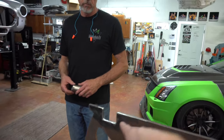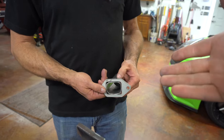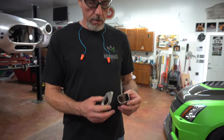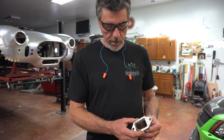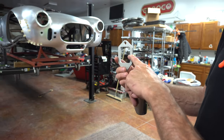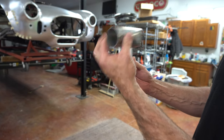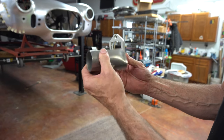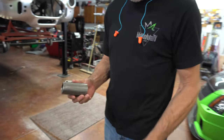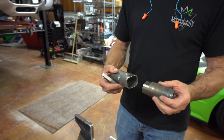Something different on this car is the flanges - he's come up with a system to make a pipe fit them. These engine ports are unlike others he's dealt with. On his LS it was a D-port so he just had to flatten the bottom, which was much easier. These don't fit as well - the ones in the car sit at an angle. He locates a centerline on the flange, then when trying to come out with a direction, marks it and carries that mark over to his pipe, then to his press.